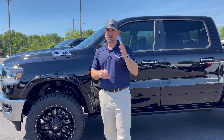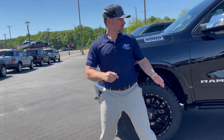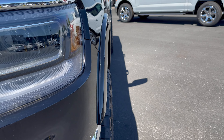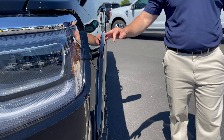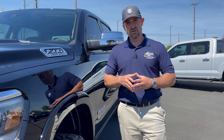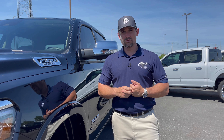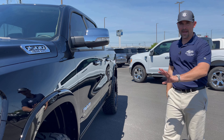Three and a half inch lift kit, 35s — zero issues, all about the offset. Let's show them our mild to wild scale. We are very conservative, not sticking out. On the Ram trucks, they've got a nice little molded, minute fender flare which helps give you a little bit more coverage. These tires stick in very nicely. You still got a 12 and a half inch wide tire on a 10 inch wide wheel — a good, stable, wider platform to give you more confidence and better handling on the road. Just a safer overall setup.